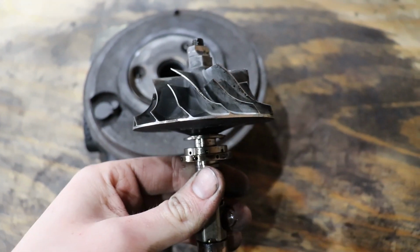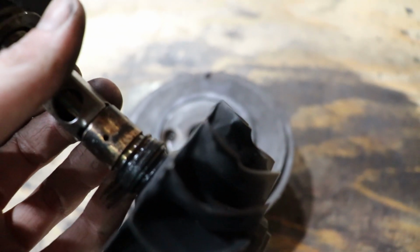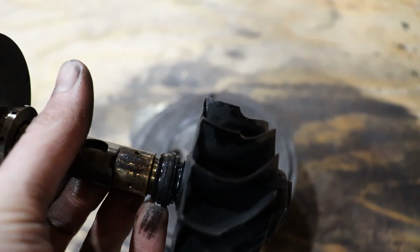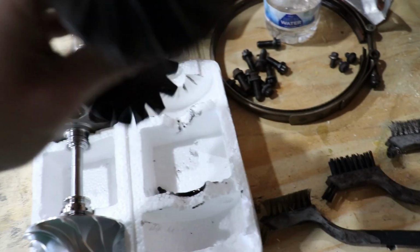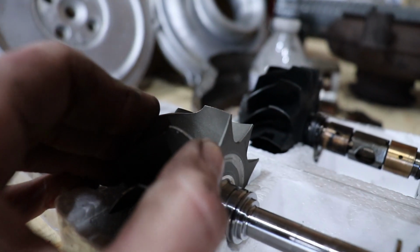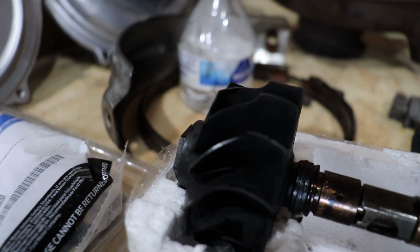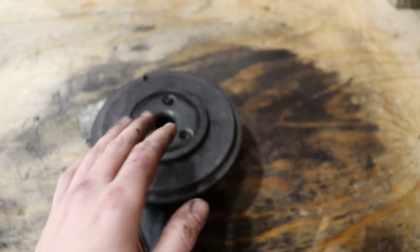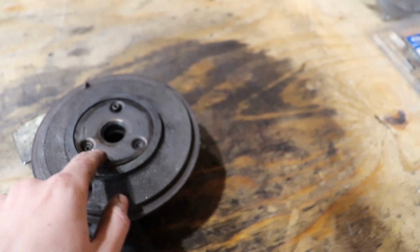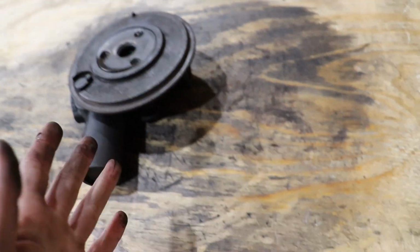So when that plate lifted up, this guy right here was just kind of burning in, and you can see right here the edges of these fins are all angled, and they're actually supposed to be flat. So as you can see on the 10-blade swap, it's all very pointy and flat, and these are all angled. So that whole assembly has been spinning and powering the truck not perfectly balanced. So that was going to ruin the turbo sooner or later anyway.